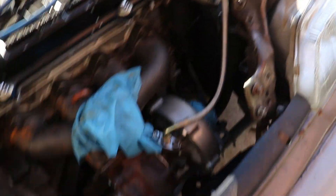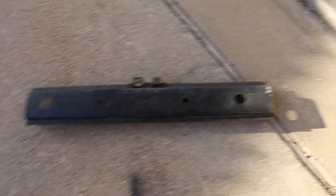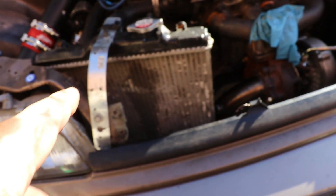What I ended up doing was routing that pipe through the hole down there where my windshield wiper fluid tank was — I need to put that back before I lose it. I routed it down through there and then came around here to the intercooler over here. That's the more traditional route, just routed around the bumper. What I had to do to my front bumper to get the intercooler to fit was cut out the middle of that core bumper support. It slid right up in — I still maintain my bumper mounts, but if I ever hit something all that's going to go straight through. So I fabbed up some intercooler mounts — pretty simple, just drilled some holes and made it fit.